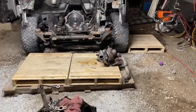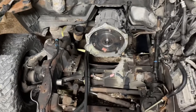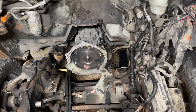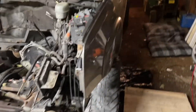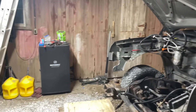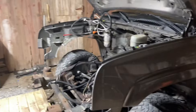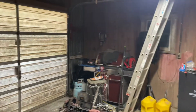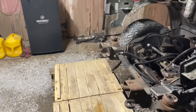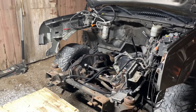Well, that wasn't the most fun thing to do, but it worked — barely worked. In the time-lapse I got all those torque converter bolts out, then took the transmission bolts out. Had to roll the truck forward because the crane wouldn't reach enough, but then the hood hit the light, so I had to put it back down into the normal bolt holes and roll the truck forward to about here so the crane could reach. Put it back into the service position — the crane barely cleared the door and the light, just touching them — and then had just enough lift to get the engine lifted off and separated from the transmission.